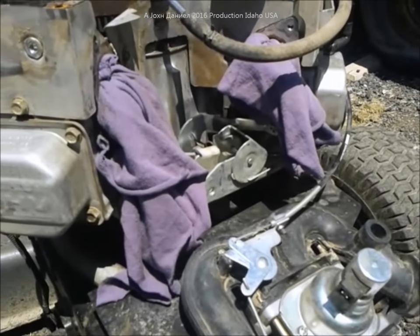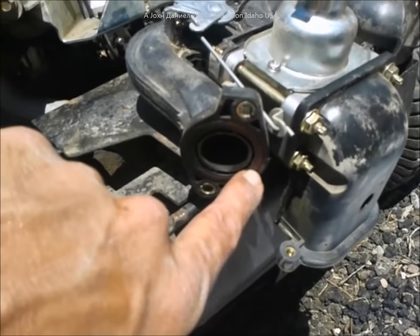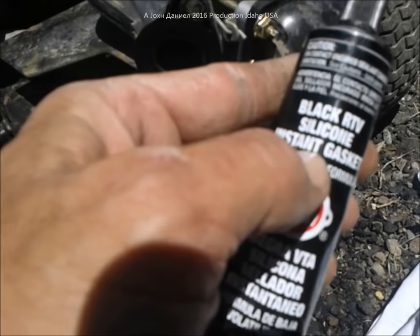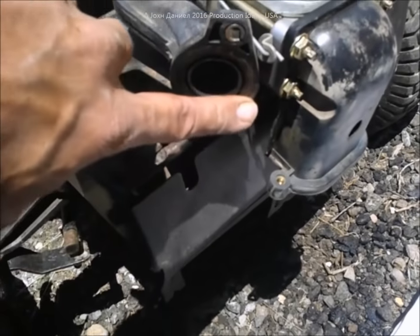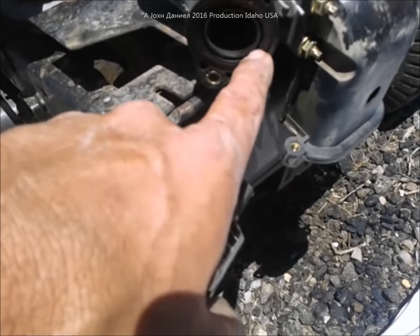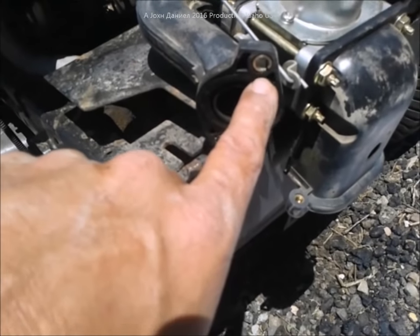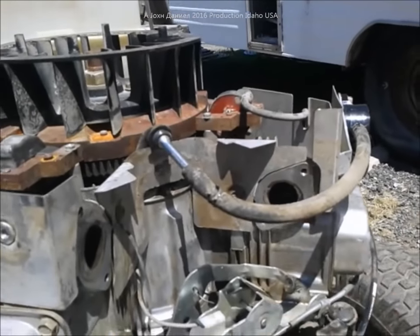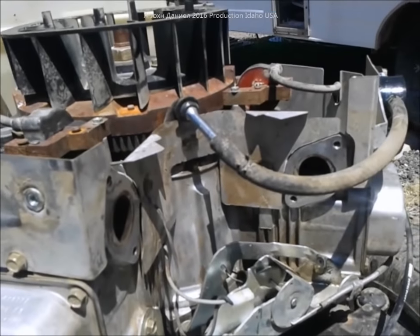A quick suggestion before you put all this back together: other than putting some rags in your intakes, if you have a few small dings in your gasket, get a standard black RTV — like ProSeal here. Put a very thin film of it on there, clean the surface extremely well, wipe outwards as you put it on, and then quickly install it. Do not torque it fully — give it about an hour, and then torque it to whatever the specs are. You can use a standard razor blade to clean the old stuff off, and once you've done that, you're ready to go.